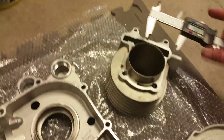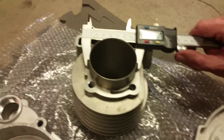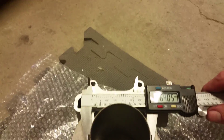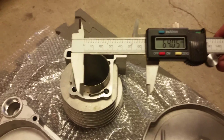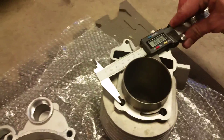This one measures right at 63.9 — we'll say 64, it did bump up to 64. My digital caliper is one I bought from Harbor Freight and it's not very accurate into the tenths of a millimeter, but it'll read to the millimeter. Anyway, I set it for 64, a little bit over 64. So half of 64 is 32, and you're going to scoot the setting down to 32.